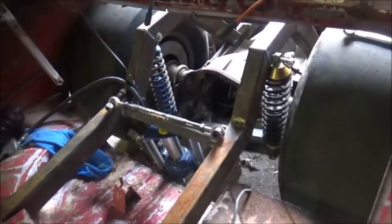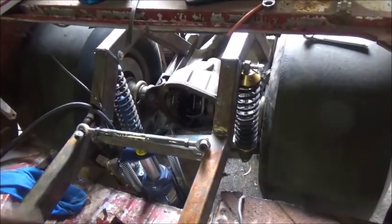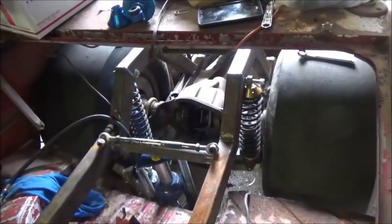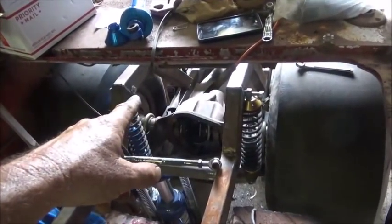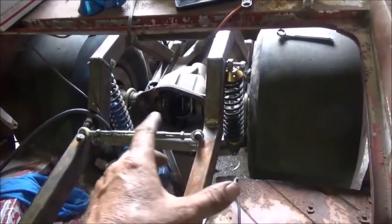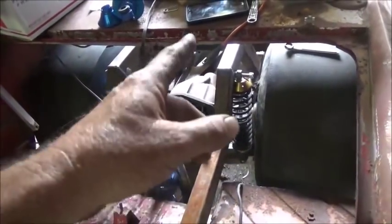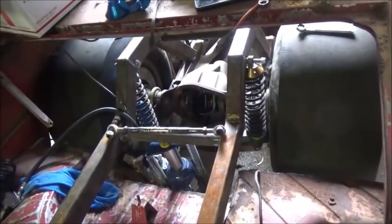I may end up running a Watts link on it, which if you don't know what one is, I'll try to explain it to you maybe in the next video. It will keep that rear end straighter as it comes up and down. There's another way of doing it, a link from the front of one of your lower control arms back to the back of your other one, and it makes it adjustable. But I don't have clearance because of the frame. My frame sits so low, and my control arms are on the outside of the frame instead of the inside like they would normally be on a lot of cars.